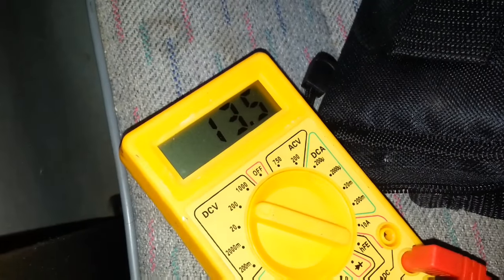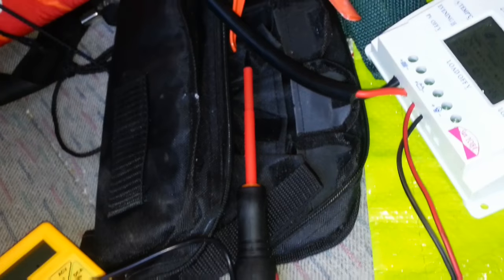One of the things I recommend: when you're stripping all the roof panel out, before you put everything away, get yourself a multimeter, stick it on voltage, and you can get a reading off the panel itself. Put it on voltage and, as you can see there, I've got 13.6 volts, which is plenty. It's charging away, and I'm not even in a very sunny place at the minute.